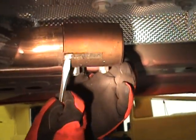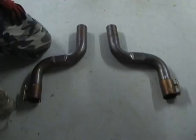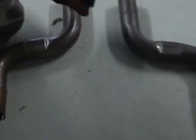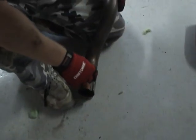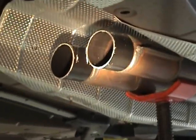In order to get that off, that tab right there needs to be released. There's a little knob, so be careful. The clip on the front right here is on the passenger side — on the driver's side the clamps are reverse of each other. Flip it over and you can see the clip is on the back edge. It won't release until the clip is released from the pipe in the front. And one last thing — don't forget to remove the tape.